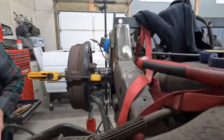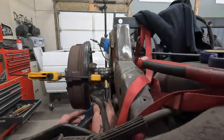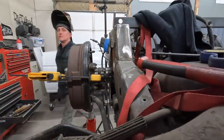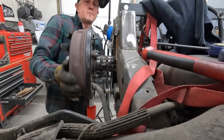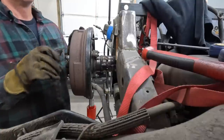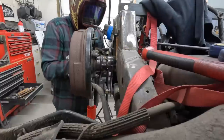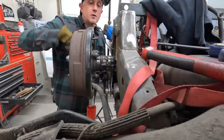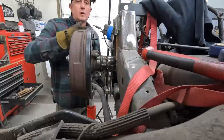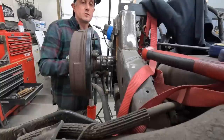That little piece of exhaust tubing should be awesome too because it'll keep me from burning through when I weld this. The axle turns super free. Here's a little trick: if you're welding on your axle, always try to do a full circle — work your way all the way around in one shot. That way if it bends out of shape it kind of works its way back to being straight when you're said and done. I'm going to go ahead and do my second pass.